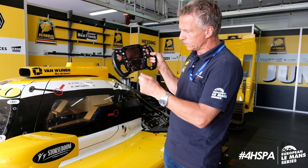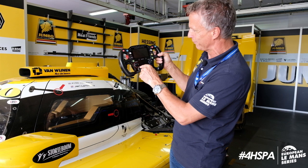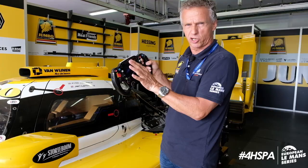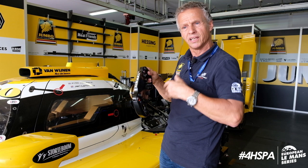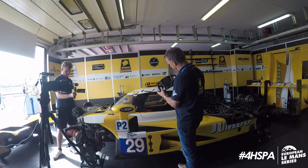On the left bottom is the power steering, so I can go from go-kart feel to a Cadillac — whatever I prefer. At my age I run it more to the Cadillac, but anyway. And here is the gearbox mapping, because the gearbox has its own shift timing. We don't use the clutch anymore, so when I press this button it cuts the ignition and gives an electro pulse or air pressure pulse to change the gears into the next gear, or on the downshift.